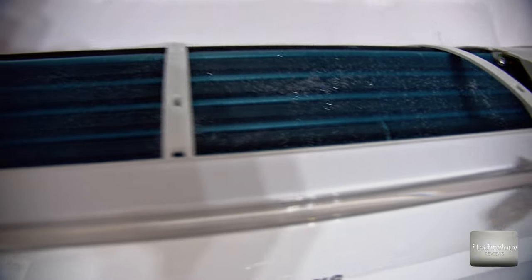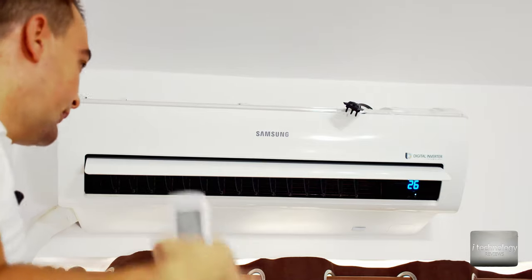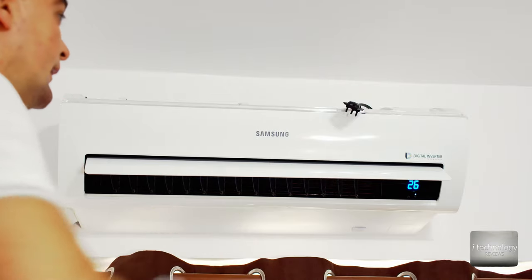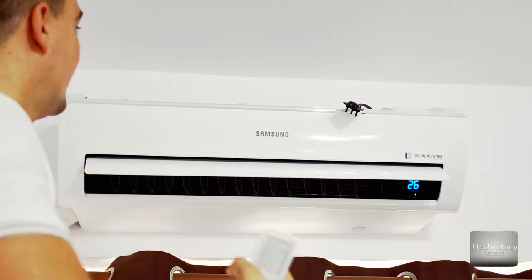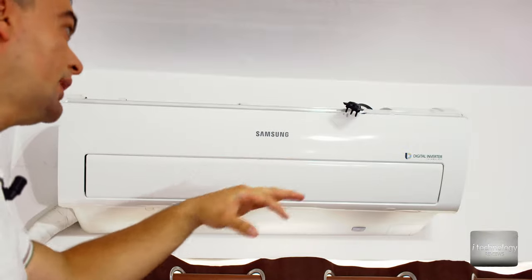The sensor is not covered, so leave the foam for 10 minutes to clean the radiator — it will get sucked in and disappear. After 10 minutes the radiator looks nice with just a small amount of foam remaining, which evaporates as we speak. Then clean the whole unit with a spray window cleaner. You can sense the fresh air coming out — the foam has cleaned the radiators inside.